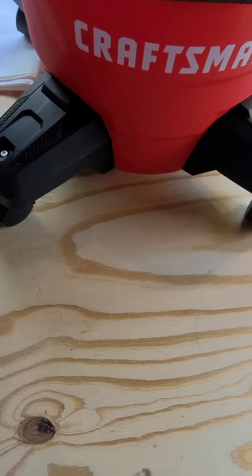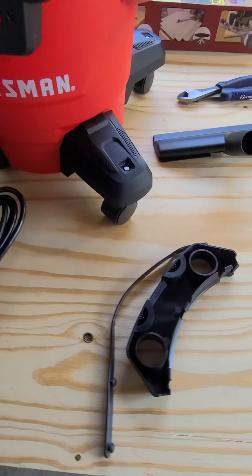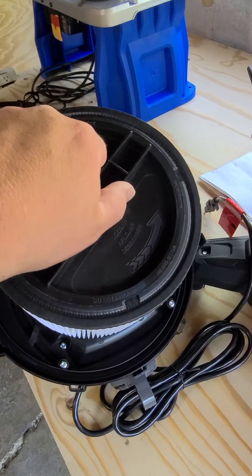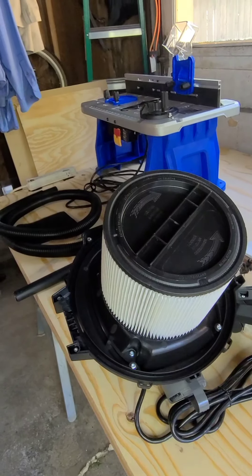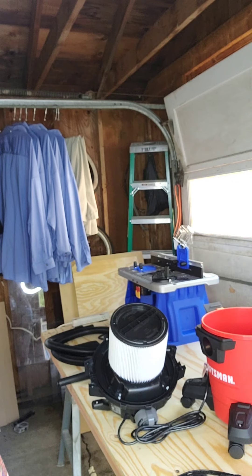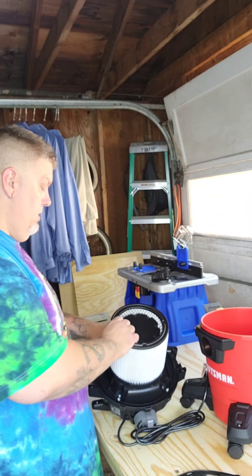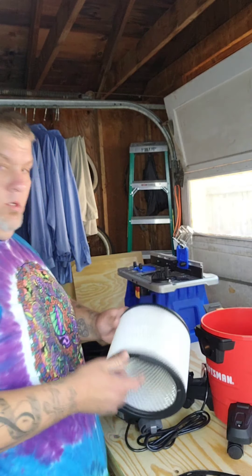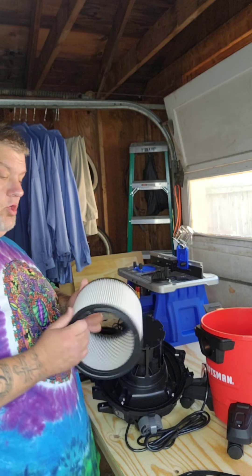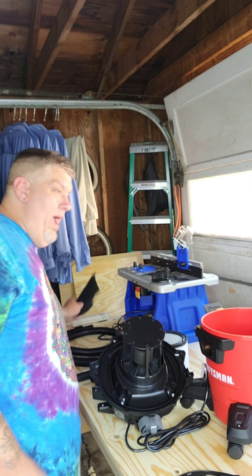I did take a look at how it kind of works here. What you want to do is set this upside down, and you can see this filter locker that locks the filter in place. With one hand you hold the filter, and with the other hand you twist this filter nut lock cover off. You'll slide the filter off — it's got a good seal. So anytime you use it, you need to take this out, bang it off. If you've got an air hose, you can blow it out from the inside and outside to clean that filter. The book says you can wash it with water, but if you do, make sure you let it dry really well before you put it back in, because once you get it clogged with wet dirt, you'll never get it out.